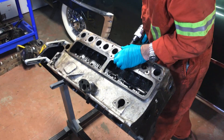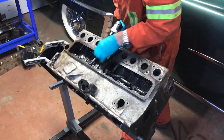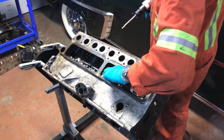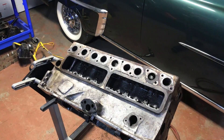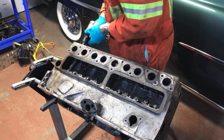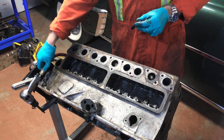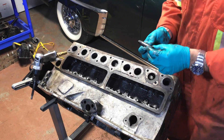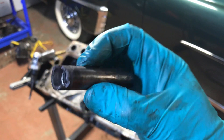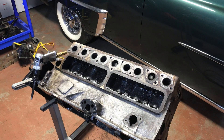Here I'm just pounding out my valve guides. They all came out pretty well except for the very last one — I struggled with it for some reason. The last one was proven stubborn, it just did not want to come out. I thought my air compressor maybe needed a minute to charge up, but it wasn't that either — it's just tight. Nice tight fit. I was pounding on it for a while and it broke away — part of the guide. Anyways, they're all out. No going back on the guides.